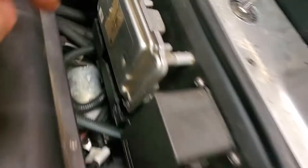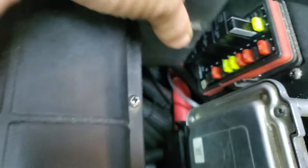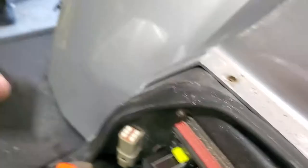Great, that'll go. Same on the other side, then you'll unplug this and this if it's connected up here. Then you're going to need to squeeze on either side of these fuse panels and remove all those fuses because this cannot fit through there. You have to unscrew these screws to get this out, and if you don't take these out you'll drop them and you'll never find them — and you can't buy these, you'd have to order them. So you're going to take this cover off — same thing over here. Be very careful of where everything is.